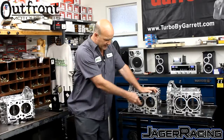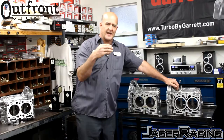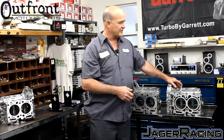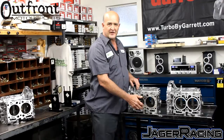On the version 4, realizing that these particular areas are prone to cracking, we milled and made the insert thicker in those specific areas — not all the way around. We didn't want to put a three-quarter-inch slug all the way across. We feel that water around the cylinder is better than having a big thick chunk of aluminum sitting there. So the thinner we can get the insert, the better the cooling properties; the thicker, the stronger it is. The version 4 block takes advantage of a thinner insert in non-critical areas and a thicker insert in the critical areas.